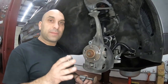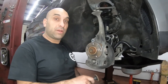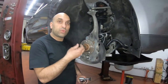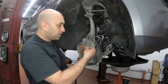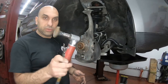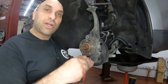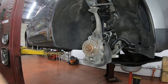Something that a lot of people don't do — especially people doing this in their garage — but something that dealerships and reputable shops do, which is very important: you have to sand down the rust around the hub. When the new rotor sits on it, there should be no rust in between — rust promotes warping of the rotor because it pushes from the inside and creates pressure in different areas, making it not flat. We use a 90-degree angle grinder with a scotch pad — it's not abrasive at all, it doesn't cut through metal, but it rubs down all the rust. Wear your glasses first.